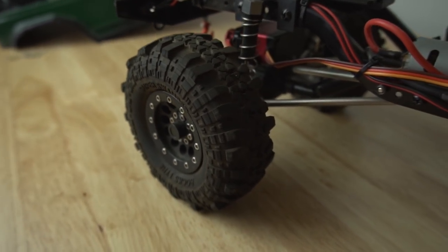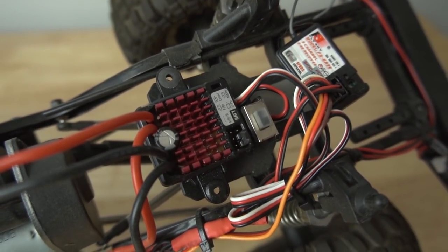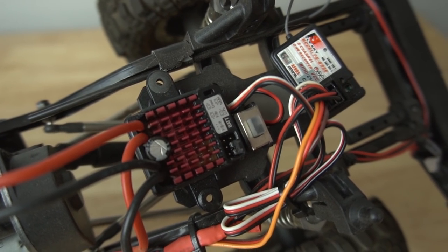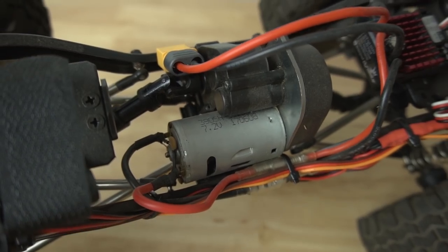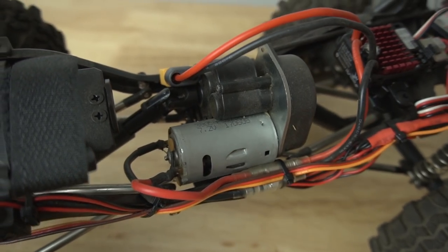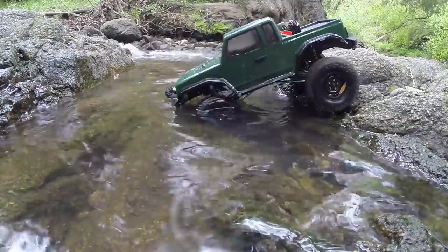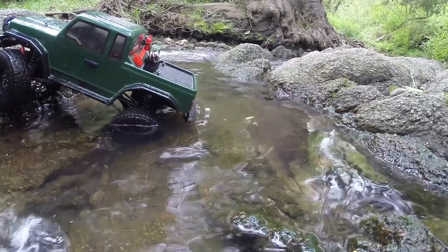I also upgraded to metal beadlocks. The electronics are pretty simple — you can switch between NiMH and lipo battery and also set a few drag brake settings. I took the sticker off the motor to allow for a little more heat dissipation. You can run up to a 2-cell lipo off this. This was also one of my first partnerships with Horizon Hobby after the HobbyCo acquisition — super thankful for Horizon Hobby.